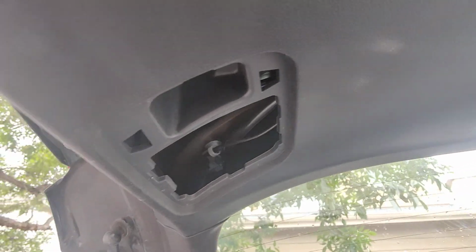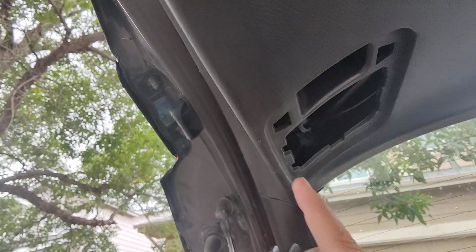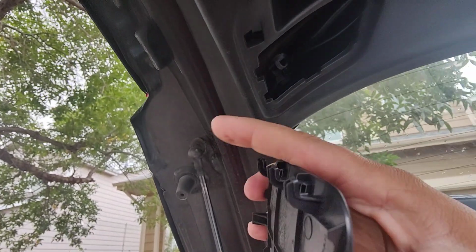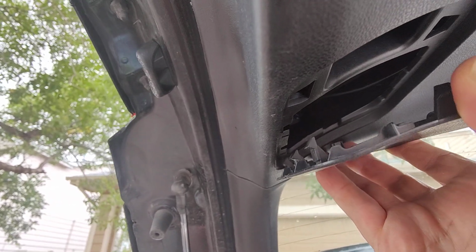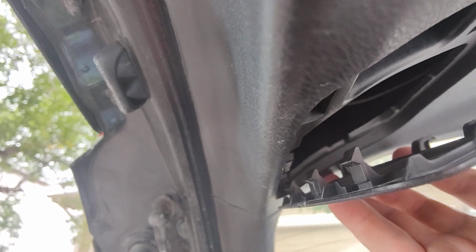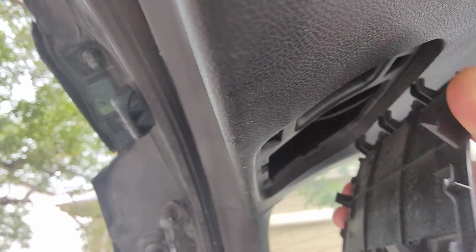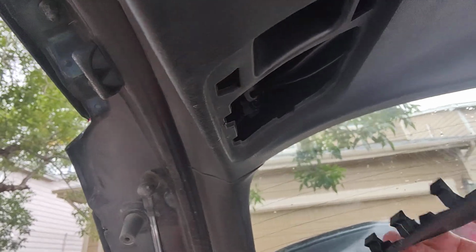But one of the things, taking this guy off, so it has these hinges. So you start from, there's a little relief on this side. So start from the outside of the car and pry open, but these hooks are pretty firm, so if you pop one, you may want to push with a screwdriver on the other ones to pop this out, and then once this pops, you pull this way. Don't try to just pull down, pull this way and out, and it'll come off.